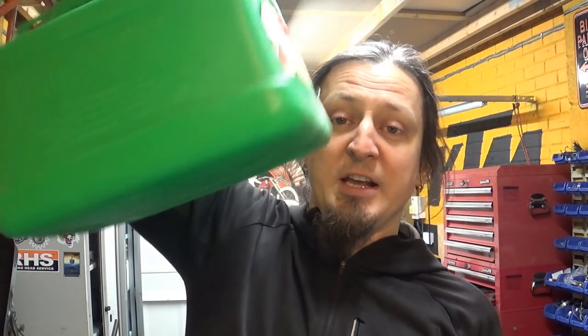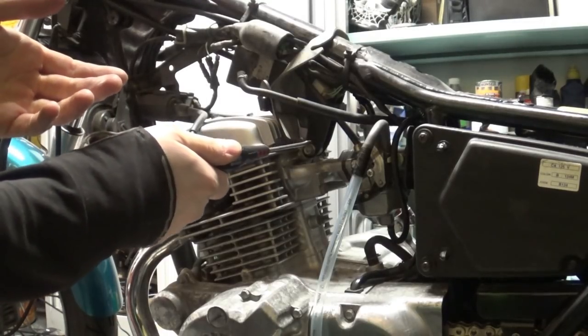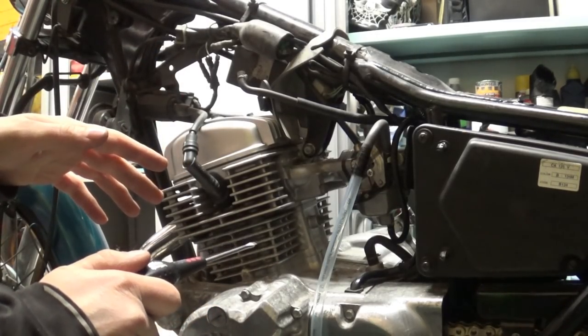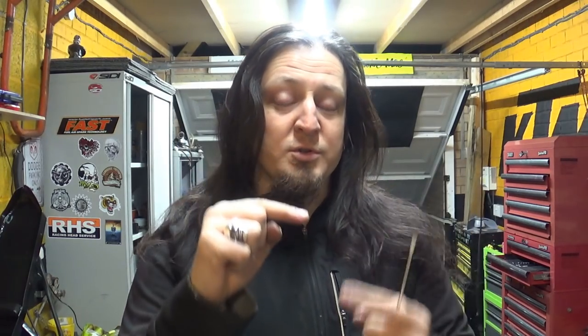I'm back with three and a half liters of fresh Morrisons petrol — no commercial intended. So we're back to the original carb with the needle raised by one notch to make the mixture richer. I've also got an auxiliary petrol tank with fresh petrol, eliminating the main tank. It did take me a number of attempts off camera — a good half hour messing with the idle speed and idle mixture screws — to get to this point.